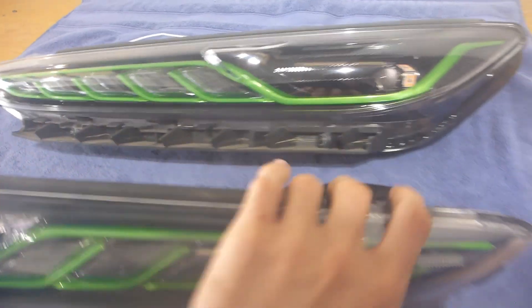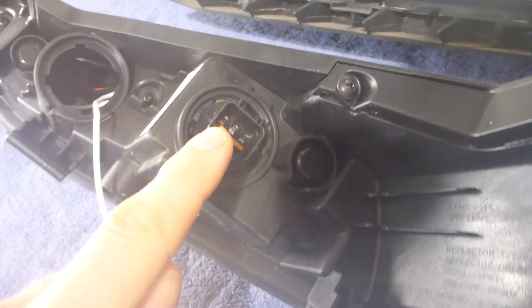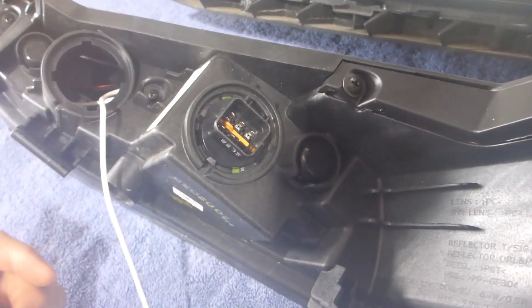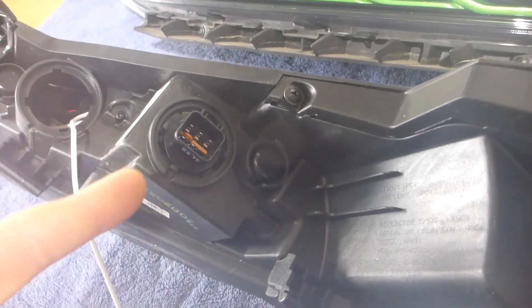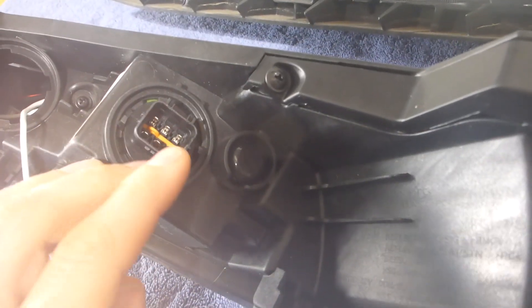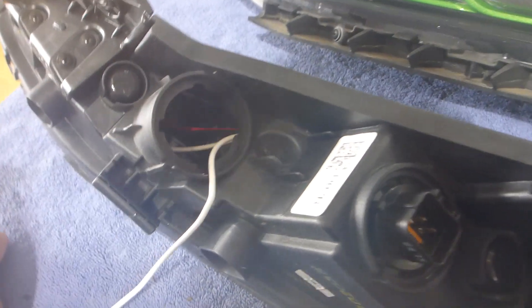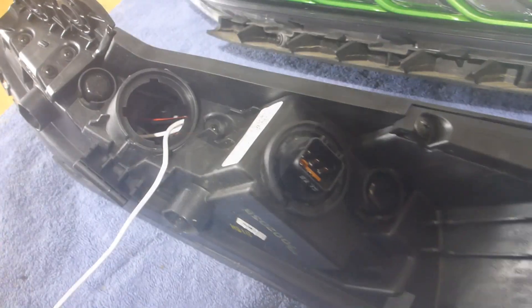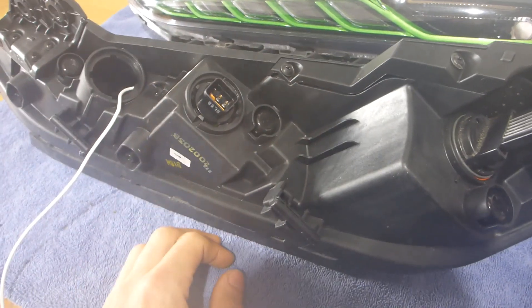Something I decided to do differently on these assemblies — that I've never done before — is how the wires come out of the housing. This is the factory plug. Originally three of those pins were used for the factory DRLs, so what I ended up doing is reassigning them to the data in, power supply, and ground supply to that UCS strip, so I get to use the factory plug. The only thing I need is a data-out wire, which is going to be penetrated right through that with a tiny little one-eighth inch hole and some butyl to seal it. This is a beautiful way to have fewer wire penetrations and utilize a factory plug.